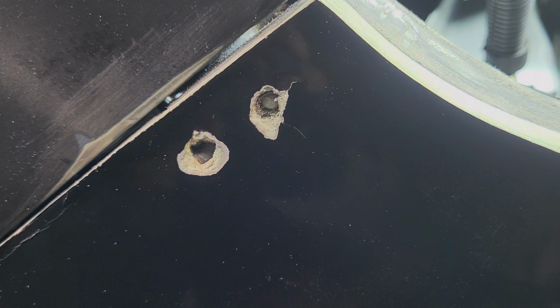Now from here on out, it's mostly just body work, time consuming processes where we wet sand, sand again, primer, sand, and wet sand the parts just to be ready for paint. Here I'm going to be taking apart the whole front bumper, taking all the fog lights and wiring, the grille, the signal lights, and wet sanding the bumper as well.